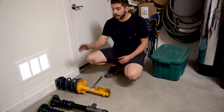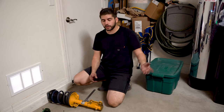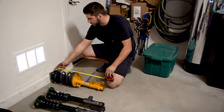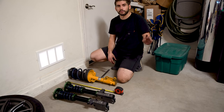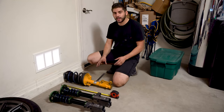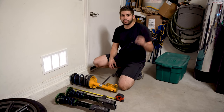We took the old shock out of the car and we have the new Fortune Auto setup here. I took both out of the box so we can make sure they're both the same length, because you want both shocks — left and right, driver and passenger — to be the exact same length side by side. The old shocks measured about 22 and three-quarters inches in length, and I measured the Fortune Autos to be around the same, but compressed it about a half inch since I want the car to sit about a half inch lower. One really cool thing — the weight difference on the Fortune Autos is insane. They are so much lighter than the old Konis, so if you're looking for weight reduction, coilovers are a great way to reduce weight in all four corners of the car.